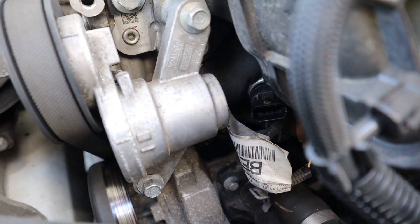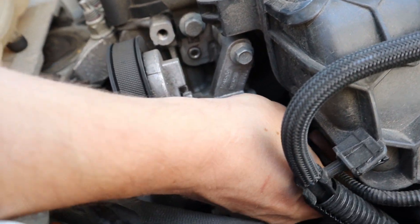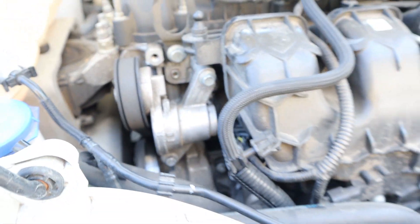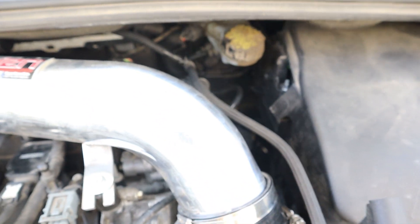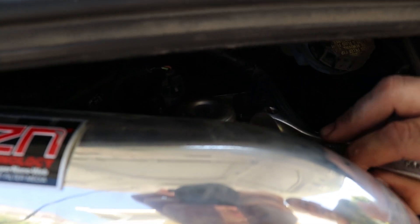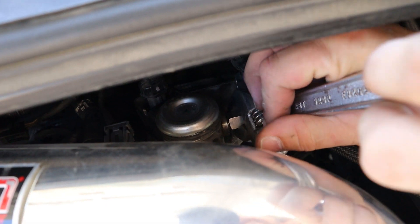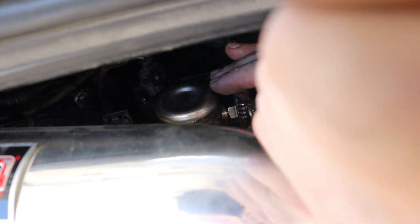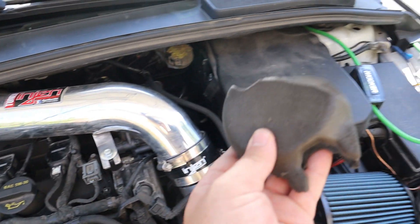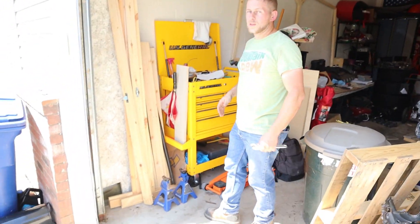Nice plug — just right here. Put the plug facing down. That's it. You've got to do it otherwise though — stick this and make sure I bring pressure back on the rail, otherwise I'm going to be spraying fuel up here. That's not a good thing. All there and tight. Want to put the cover back on? Nah, it's just an easy switch — it's got to be pulled off anyways.